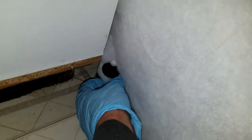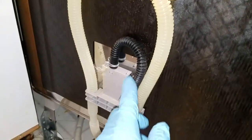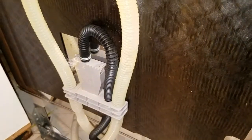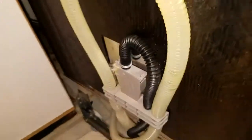There's a little plastic Christmas tree fastener — don't pull this out. All you need to do is work the insulation around it, and this won't tear it if you're careful. Just lift this up. What I suspect is this inlet hose here — this is what supplies water into the inside of the dishwasher. You can see it clamps here, follows all the way through here, and goes on the inside, which I'll show you.